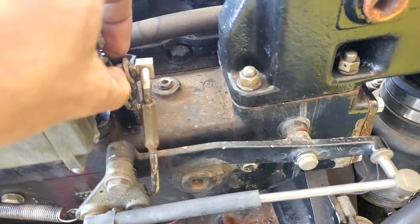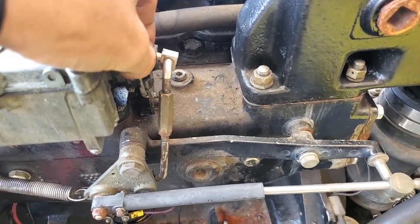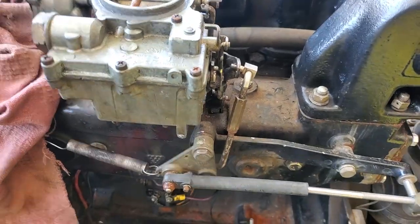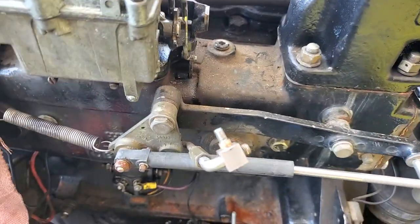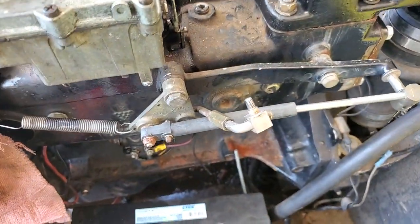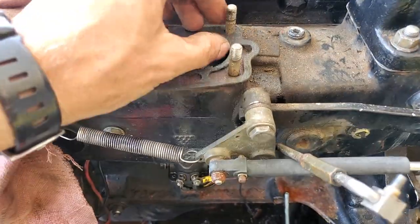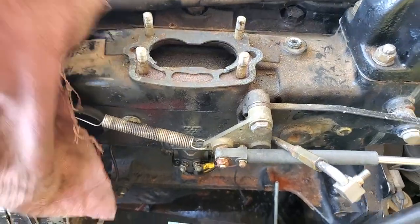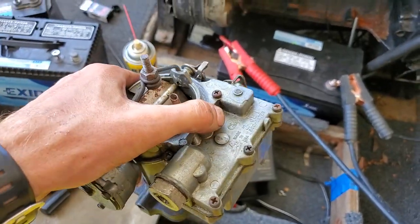So I've got my nut coming off here. Always try and undo the least amount of nuts — don't go and take everything apart. Just undo as minimal as possible to have the carb completely free, and it pretty much just lifts up like that. Now this is a customer's boat. It's running fine, but he just let it sit for a very long time and it's not running well — I'm suspecting the carburetor. We're gonna go to the bench and I'll show you how to open this and just clean it.